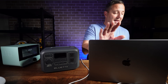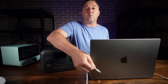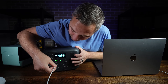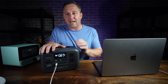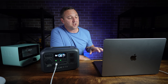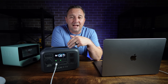Here I have my 16-inch MacBook, which pulls quite a bit of power — the USB-C cable on this MacBook can pull up to about 140 watts. I want to plug it in and see if the USB-C will pull at least the 100 watts it's rated at. Currently at 70% charge, we're bumping up to 90, and it looks like we're getting 91 watts from the USB-C outlet. I'm not sure if that's the MacBook protecting the outlet because it's not Apple-certified, or if the device is simply limited to 91 watts.